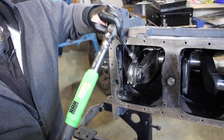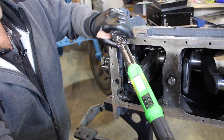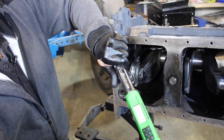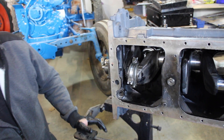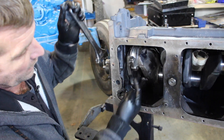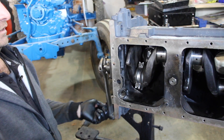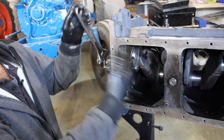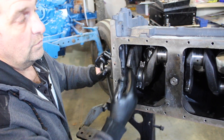What I like to do is bring it so far, so you know you're not pulling one all the way down to its finished torque. Nice and gentle — on 65. There we go, that's now torqued up. What I then like to do is turn it. By doing that it's now turning on the lobe of the crankshaft. I can turn it with my finger — there's no tight spots. If you put them all in then decide to check, you won't know which one has a tight spot, so work your way down.